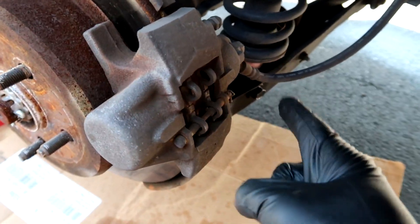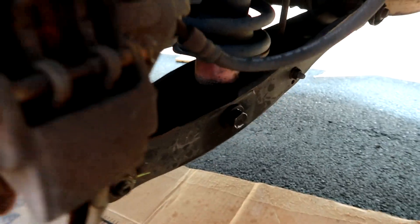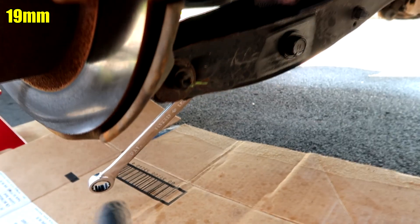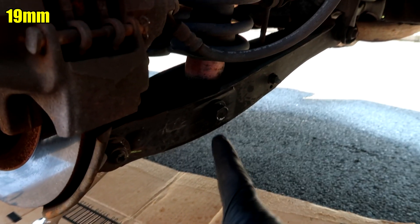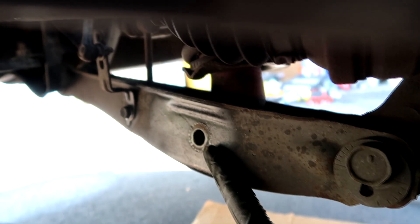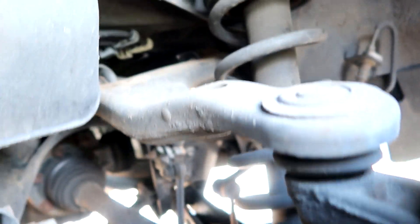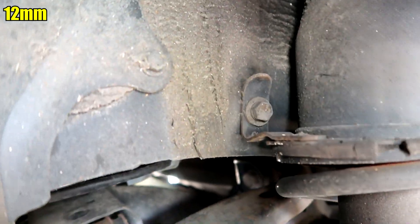While they're working on the ball joint trying to separate that, me and Brendan are in the back right now going to take out the rear strut. The bolt right here is a 19mm, so we have a 19mm wrench and we're just gonna send this right off with the air gun. With the back bolt out from the strut, we're gonna jump up to the front and take the bolt out that connects it to the rotor. And you also have a 12mm bolt there, and there's another one there.